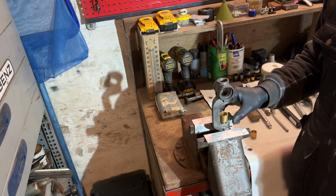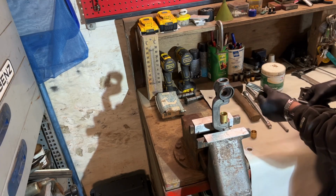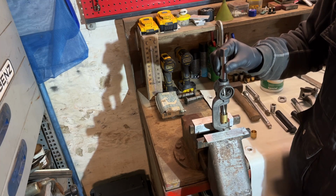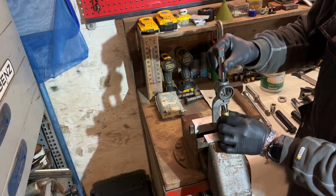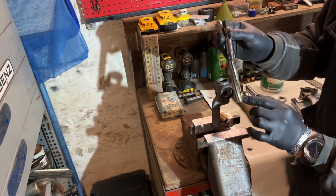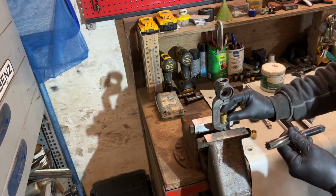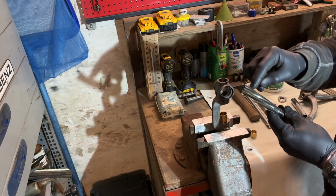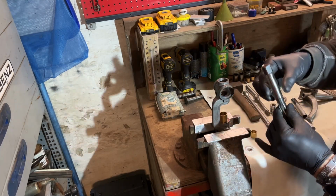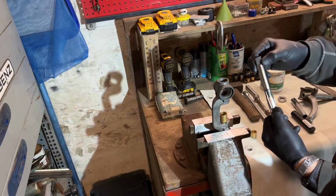So the bushing is a perfect fit here. And with that reamer, you have to go from here to the other side to ream it. Yeah, now you see it's a fit. So this top end is 17 and a little bit more. I guess 17.7 or 17.8. And it goes from little to 18. This shaft here is 18. So this is from here to there, that's 18.